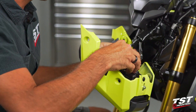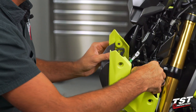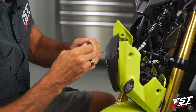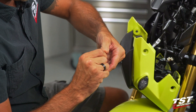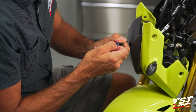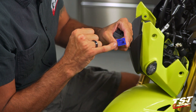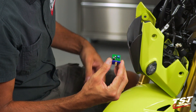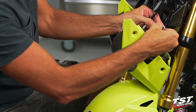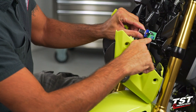For those who want to adjust the flash rate, unplug the relay, remove it from its keeper, and slip the gray cover off. Using a small flat-head screwdriver — though it's also possible by hand — clear the tabs from the receiving features on the blue component and it comes out. Then plug the board back in to the OEM plug, and we'll be ready to start the adjustment process using the potentiometer.